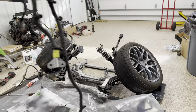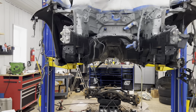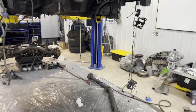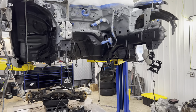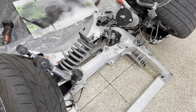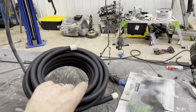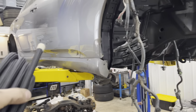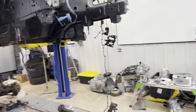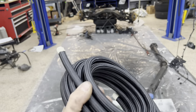Because we are running high horsepower, we are going to run a line from the tank all the way up into the firewall, and we are going to be running an 8AN. The shop is very messy from painting obviously, but I'm not going to sit here and watch the paint dry. The next thing I'm going to do is mount the front subframe and then swap the rears with the other car. In the meantime, we're going to go ahead and throw our PTFE 8AN and route it from the tank up to the firewall. I'm not going to film this whole thing — there are a ton of videos on 370Zs and G37s — but I will show you some tips and tricks on how to run this.